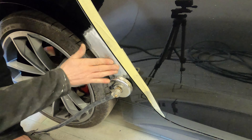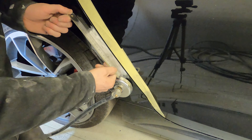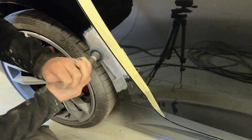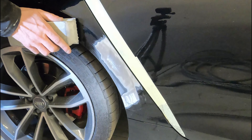We're trying to get it as flush as possible but not leaving it raised — if we leave it slightly raised we're going to end up with a high spot when we do the filler work. I'd rather leave it a tiny bit low or as close to level as possible. I would use something like a flexible ruler or straight edge to make sure nothing's too high before you take your welder off and finish up.